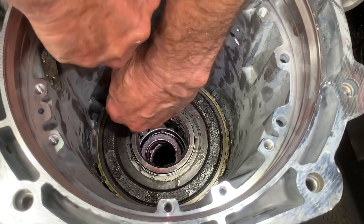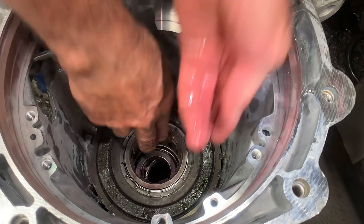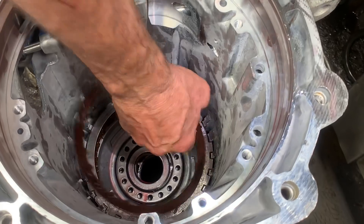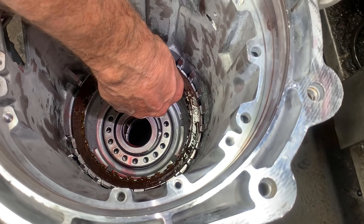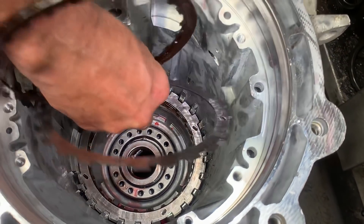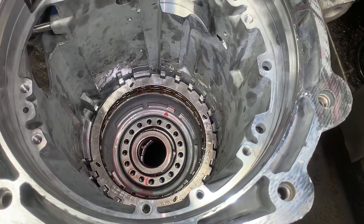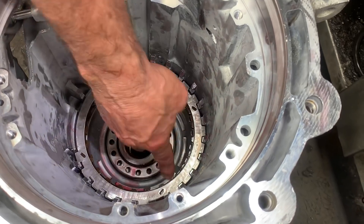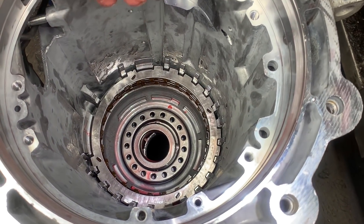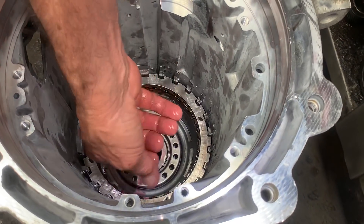So how I'll do that is — either I will go get a 0.350" clutch that is about 0.030" thicker and put it on the top here, which is probably what I will do. Or I'll take two of these clutches here and grind the clutch material off on each side, put them together, stick it down there as one, set it back in there and check it again. Put it all back in there like that, get another clutch with both sides ground off, stick them both down in there and check it that way. If that doesn't work, normally a 0.350" clutch will work really well because it is thicker to take up that gap. But that's how you do that — that's the best way to make these shift manually without hurting anything and burning up this clutch, because it releases so fast.